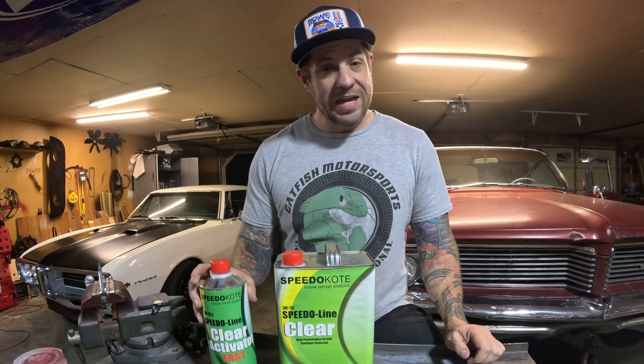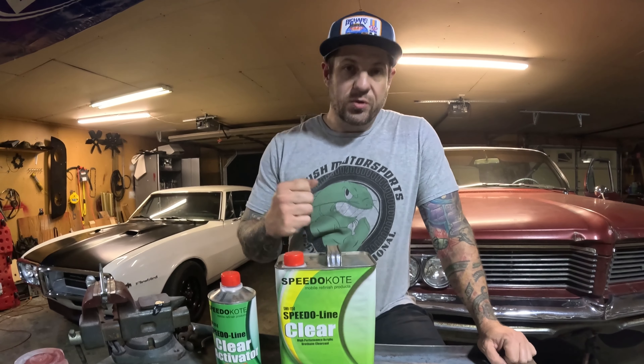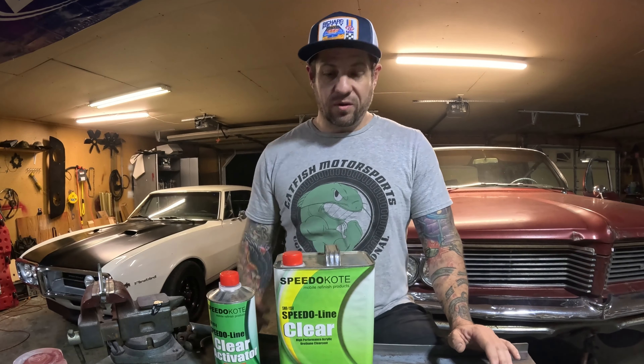Now for the secret weapon — and it's kind of a double secret — this is my secret weapon for pretty much every paint project: 2K urethane clear coat. It's two-part. You can buy it in bulk and use a gun, or get it in a spray can where you push a button on the bottom to activate it. The downside to the spray can is you pretty much need to use the whole thing within 24 hours. I keep a gallon of this around — if I paint an engine, anything I want to stay shiny for a long time, I put this on it. It's really hard, really durable, and it shines like crazy. After I finished painting the wheel, I put this on it and it should keep the shine lasting for a long time. That's it — just a quick and dirty overview of how I made my wheel much more palatable than it was when I got the car. We'll see you next time.